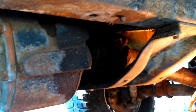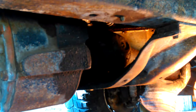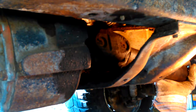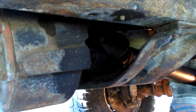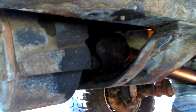I've got to put this up — let me get to where... oh, I can see both of them from here. But I don't see any grease zerks. There's another set back here. Yeah, they're the non-greaseable type, and I don't believe there's a grease zerk up in the U of the U-joint either. So these can't be greased. The front one can be a zerked — it's an old standard kind.